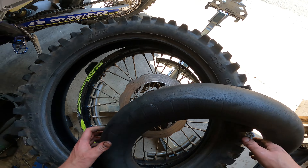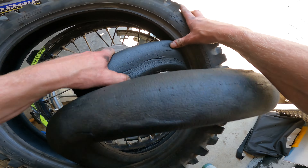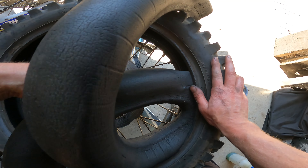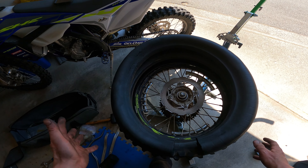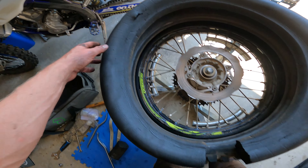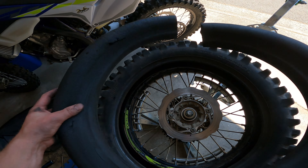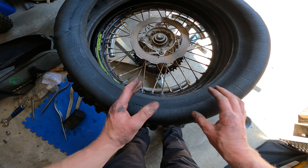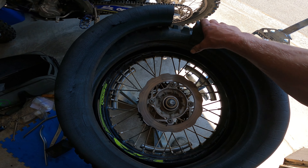And you can see how it's still filling up most of the tire. It hasn't shrunk a whole bunch, but they do shrink. Here it is — 200, maybe 250 hours. That's from a spoon, obviously. There's not a whole bunch of wear and tear. It's nice and soft. That's the good thing with these soft nitro mousses — they just keep getting softer and softer and the traction gets better.